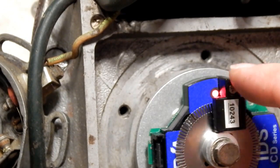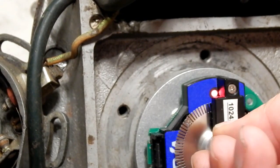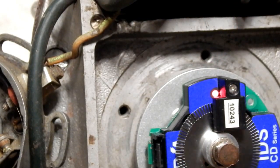You've seen the light is on right there — it's on TDC. Now you'll tighten the screw. When you're done tightening the screw, you want to make sure that the light is still on. At this point your ignition is set.